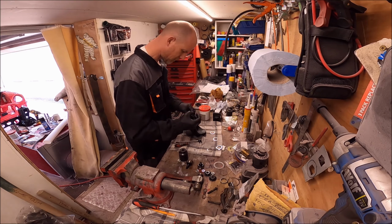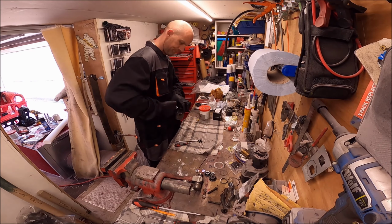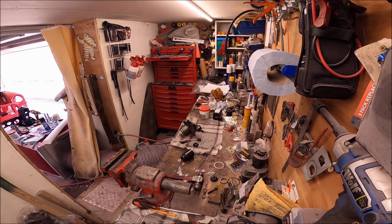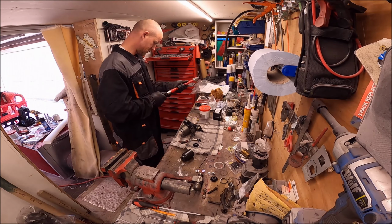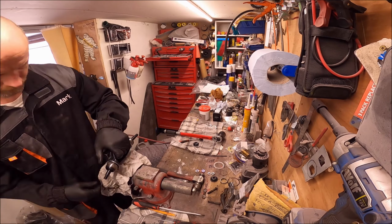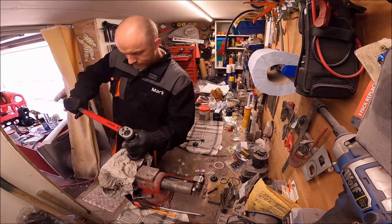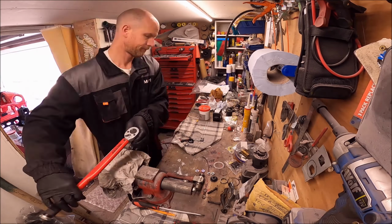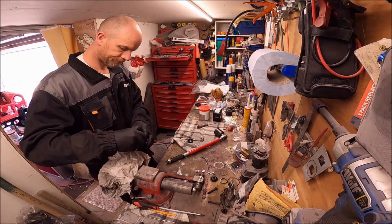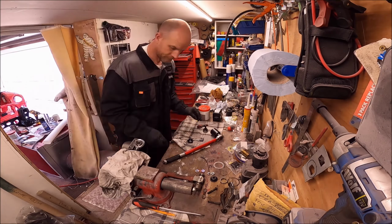So you might never have experienced bump steer, or you might not have recognised it. When I say it causes the steering angle to increase, depending on the steering geometry, it can actually do the opposite, but in most cases it increases the steering angle. So if you're going around a corner, say for instance around a roundabout and there's a bump in that roundabout and the suspension compresses or goes up, where you have a shorter top arm and a longer bottom arm on the track arms, that causes the steering angle to increase. So it gives the feeling of the car turning in tighter.